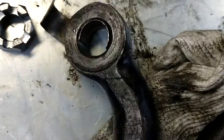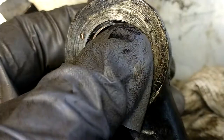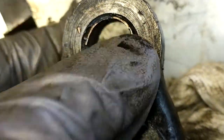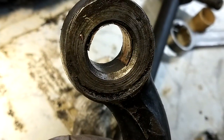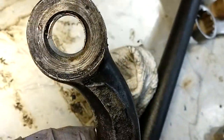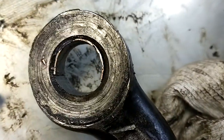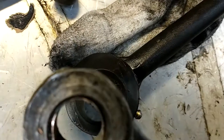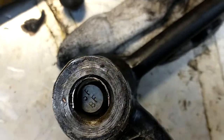I had to make a little bit of a shim because the tapered shaft on the drag link wouldn't get tight enough and it would kind of wobble in there. It wasn't terrible, but it was enough to bother me. So I took a piece of copper pipe clamp — the kind meant to hold a piece of pipe against the wall, a quarter inch piece — and just cut it, shaped it, fit it in there. Then I put the shaft in, kind of drove it in to press it in there, and now it fits nice and snug.